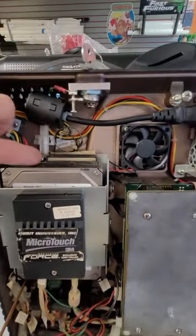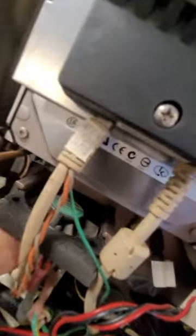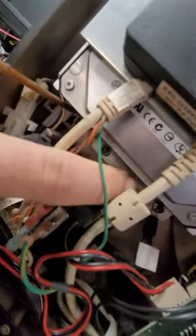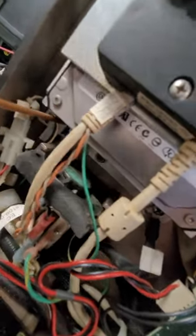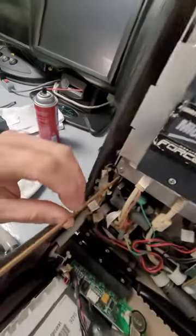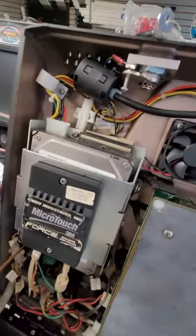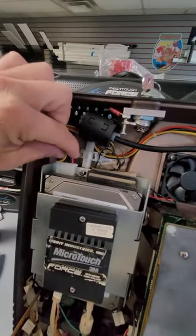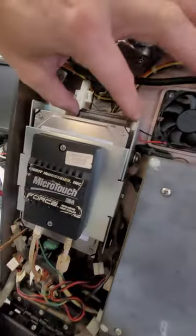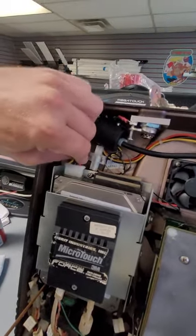You're gonna have a screw here and two screws down at the bottom below the hard drive. This hard drive will then be able to lift out. You may have a cord here that's holding the front screen from falling forward as well. You're gonna have a power plug here and then the hard drive plug here — they just wiggle up and out on both sides just like this.